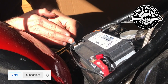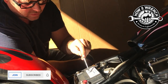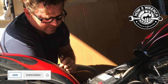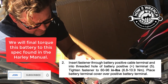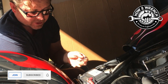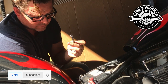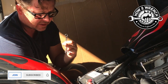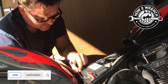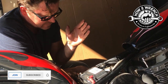It takes a while to cool down. I'm going to tighten this up now. You might be wondering, how tight do I get them? There are torque specs, and these are solid terminals. Where people really get into trouble is they look up a torque spec one time and think that must apply to all batteries. When this is a solid lead fitting, it has a slightly higher torque spec, but if you're pulling a nut up through a hollow terminal — especially on a really cheap battery — it's going to be a lower spec. Honestly, most people find it's about feel. Get it where it feels tight, then try to wiggle the cable. If you can rotate it, you've got a problem.